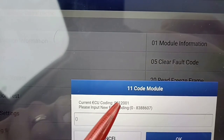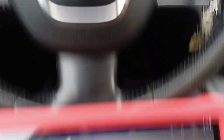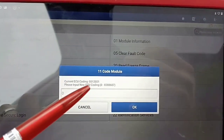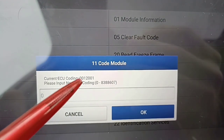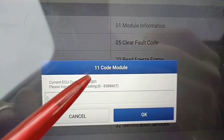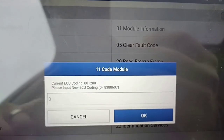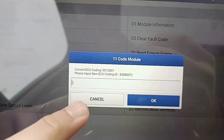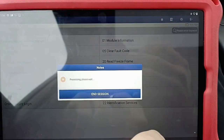This is interesting — maybe it is the reason why this doesn't work on this car, because it's aftermarket. They replaced the light with an aftermarket one and maybe it was not correctly coded, because you can notice we already have 2 instead of 3 here. Maybe this is why it doesn't work. In my case I will keep it as is — I don't want to change the code because it's already 2. I go back and we will go to the gateway module.